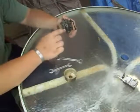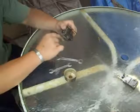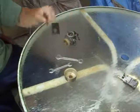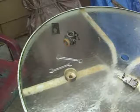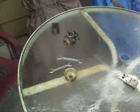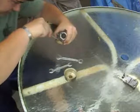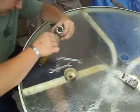What I need to do here is pull the float assembly off and take the piece and adjust it so it closes sooner and it won't leak on me. I think I might get away with just using a screwdriver. Now here I've got one of my smallest screwdrivers — I'll use it to bend the tab. That's too soon, so I'll try and bend it down a little bit.